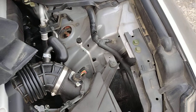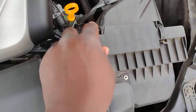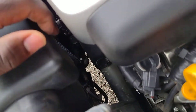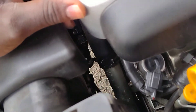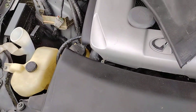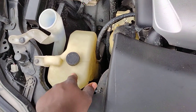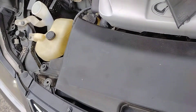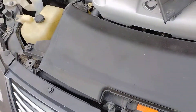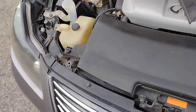Quick glance — your air filter is still looking good, but we still have the clip issue. Seems like you'll be coming to Terre Haute a little sooner than you intended. I'm glad we could meet today so I could look at it. Go ahead and buy some coolant and add it in there even before you get on the road, and let's start planning on the radiator replacement.